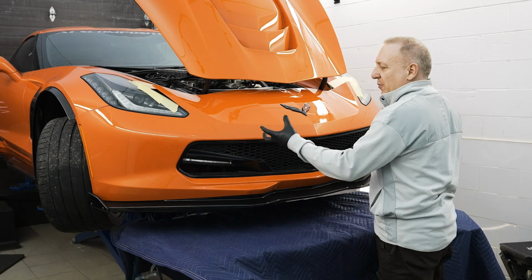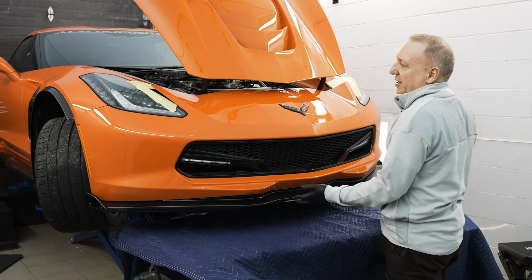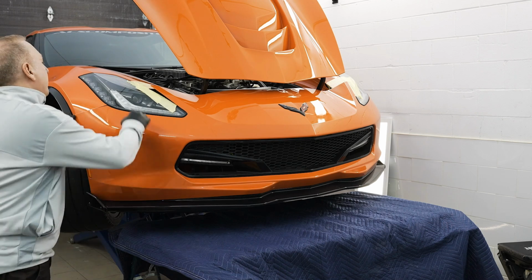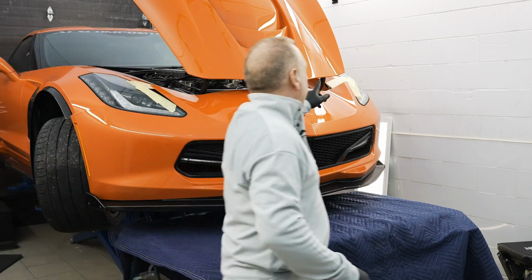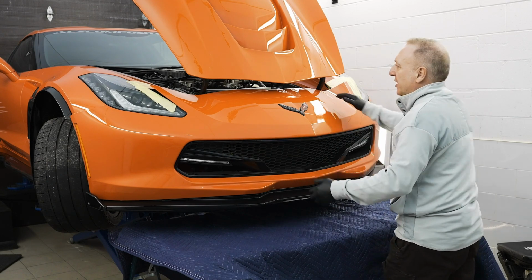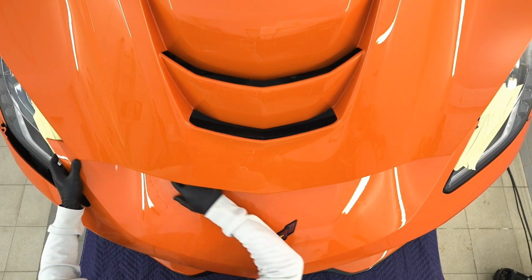Now the fun part, we're going to be sliding the bumper off. I'm standing it directly on this table. If not, you should have one guy on each side, making sure my snaps are all removed. Sides, top, the other side. I'm going to be lifting and applying it. There's a return flange here. I'm clearing the car. So here we go.